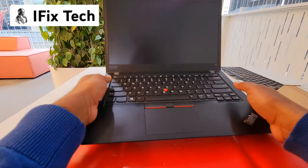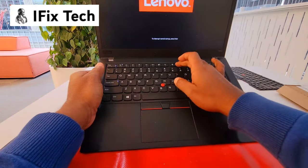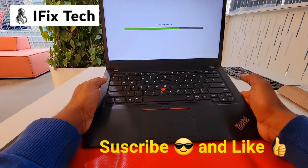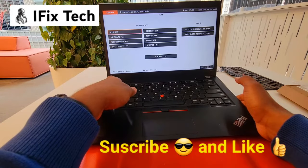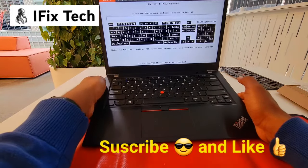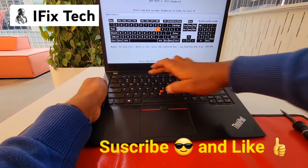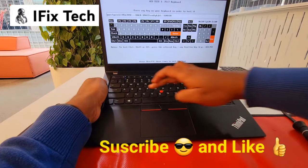This is the process of swapping the keyboard. You can test each key — go to F10 while the computer is booting up. On the diagnostics screen, go to keyboard, select number three, and you'll have a digital keyboard layout where you can press every single key and make sure they are all working.